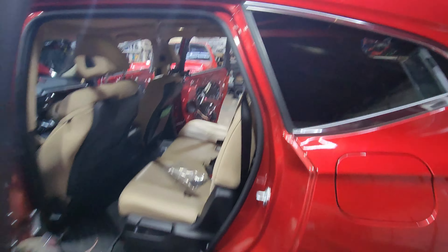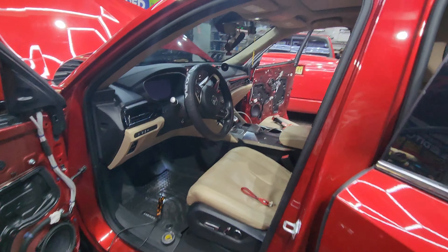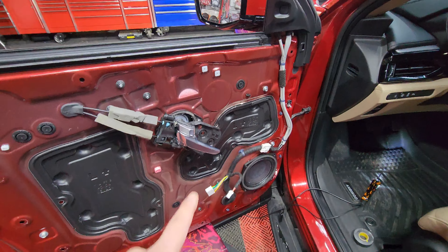Now that we got all the doors out of the way, these ambient lights don't turn on magically — they obviously need power. Usually they come in a kit like this; this is the power and the ground. Fun fact about the latest generation Acura MDX — in this case a 2022 — there is constant power in each one of the doors. All you have to do is tap into that power, and of course there has to be a ground right next to it. You want to probe test it before you connect so you know exactly what you're tapping into.